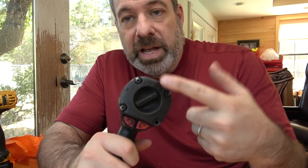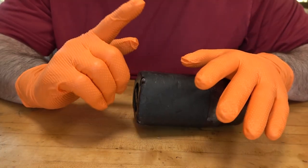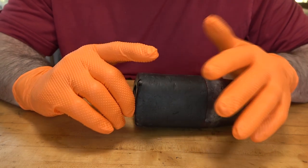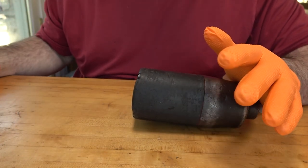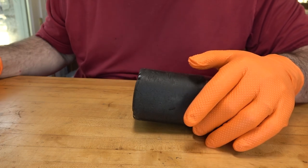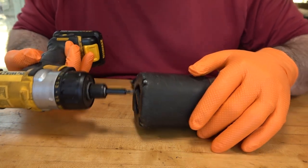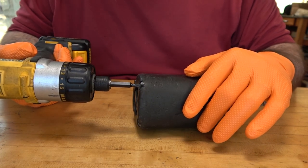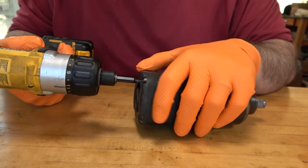We're going to start with taking off the body screws — there are four of them; usually the ones on this unit are a T15. I've never disassembled a 2131; I've disassembled plenty of 2235s and this looks, judging by the schematic, very similar. But we're going to go slow and make sure we note the way everything comes apart so that when we put it back together again we're not confused. I use a power driver for the screws back here — it's not necessary, you can do them by hand, but this is a very controllable power driver because it has a power setting where it relieves the clutch.